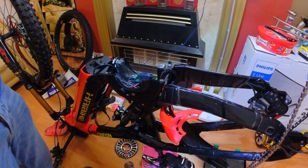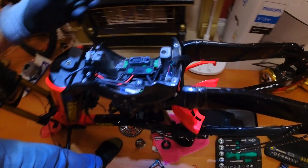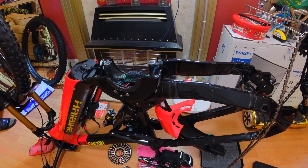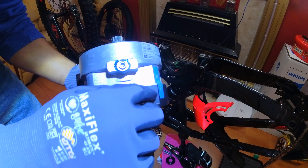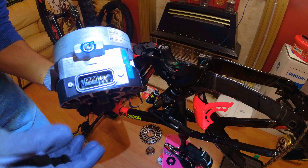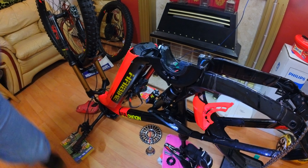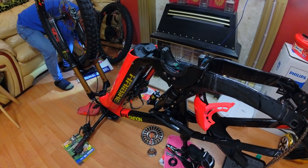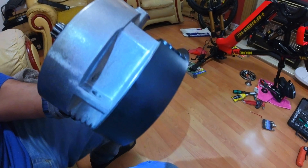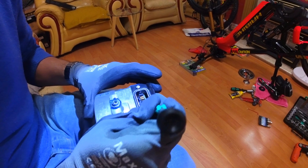There is an O-ring that can fall off or not seat properly when you take the motor away. The fitting here is not rectangular in shape, so the O-ring can come loose. I've used a special silicone-type glue to hold it. Let me grab the motor and show you — I'm going to remove this O-ring and demonstrate how to reseat it.